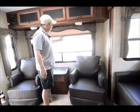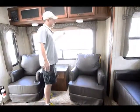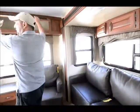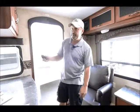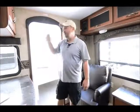A really nice feature with the rear living layout — you have two chairs in the back and a nice big back window. There are day/night shades: at nighttime you get the darker shade, and if you want some light but want privacy you can use just the day shades. There's good storage up here all the way across. I mentioned the remote for the awning — you've got it right here. This remote also runs the slide, so if you're backing into a tight area you can stand outside with the remote, open the slide out, and make sure you have enough room. It also runs the awning, so if it starts to sprinkle or the sun gets too bright, you can pull it from your pocket and open the awning with one button without even getting up from your lawn chair.